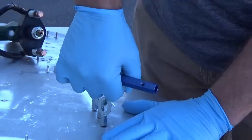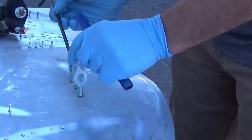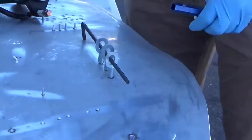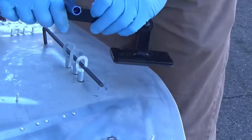There are a variety of ways of repairing the damage once the studs have been set. For working on a crease, you'd place several studs together and place a steel pulling bar through the key heads, then use the leverage bar to provide the power to pull.